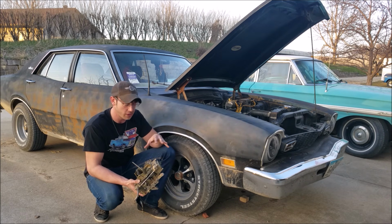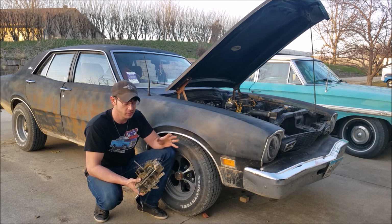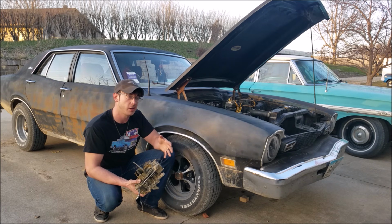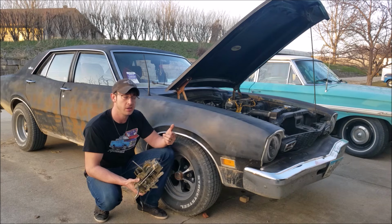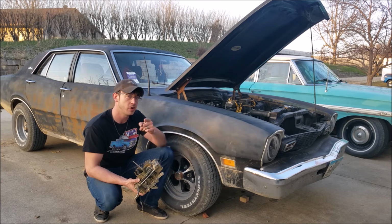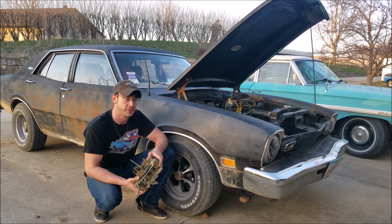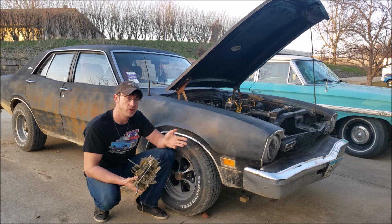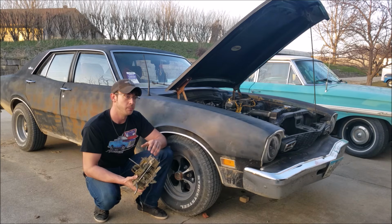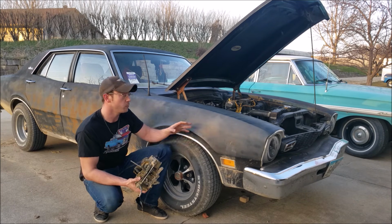This whole series was actually going to be about carb sizing, where everyone way over carbs their engines, and that's what's given carbs such a bad name. There's CFM calculators online for your engine size and the max RPM you're probably going to take your car to on a regular basis, and I do recommend you check those out. I'll leave a link below. All the TV shows and everything showing big dyno numbers, yes, you can make that with a big carb, but all your drivability and your fuel economy down low, where you use your car, what are you doing with your car?